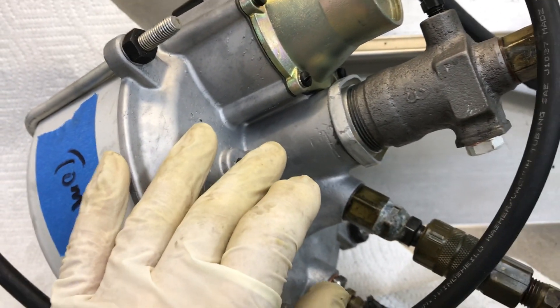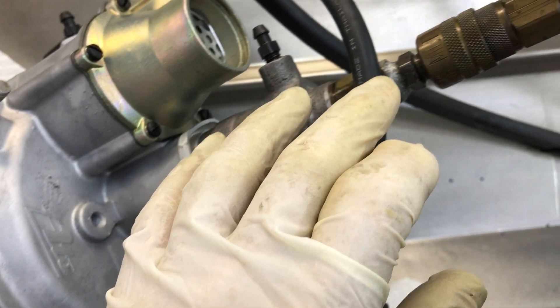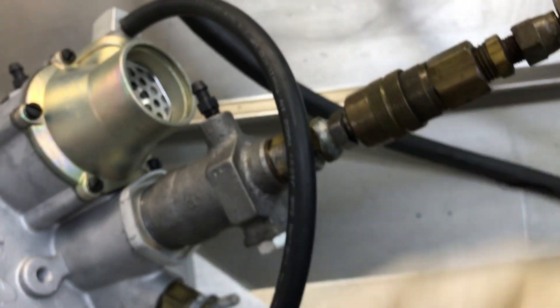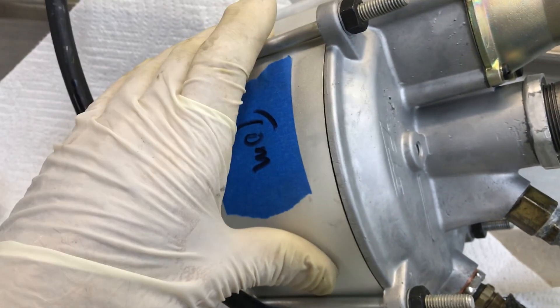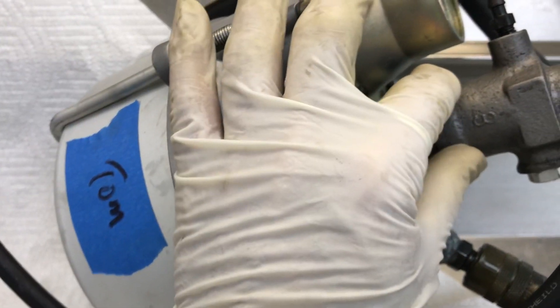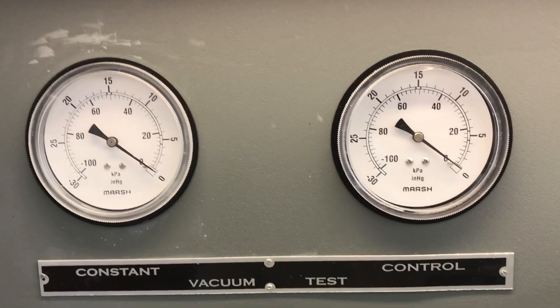This is your input right here — this goes into the booster from the master cylinder. Then the vacuum is applied, the piston activates in here, and pushes out the fluid here. As you can tell, there's a dramatic difference in size between the vacuum piston here versus this side — and that's how you get that much boost. Now we're going to try the same thing with vacuum.